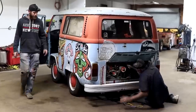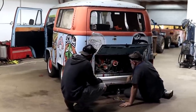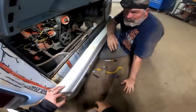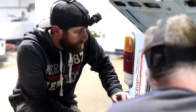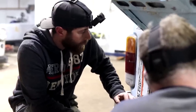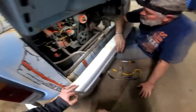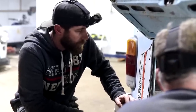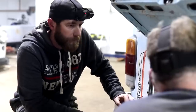So close. Yep. You reckon those plugs need to be pulled out and cleaned? It could be. We're trying to jump the gun on everything. We know we're getting fire to the wires, though. Right. You said it was getting a good spark there, right? Yeah, really good spark, right across here. So if them spark plugs are fouled out, that's going to keep us from it running like it needs to. Right. Because we know we're getting gas. We're pulling it straight into the carburetor. Right. So I think we're just not getting quite the clean fire that we need to make it work. Or it could be a weak coil that's kind of giving us issues. True, yeah. I say let's pull them plugs out, clean them up, check them while we got them out, and then we'll bounce back to that coil if it still gives us issues.